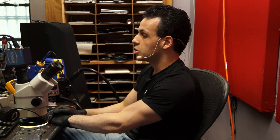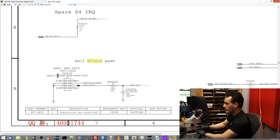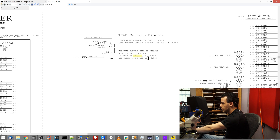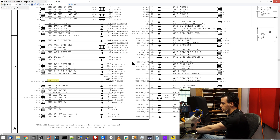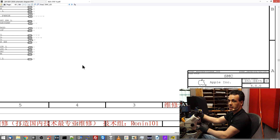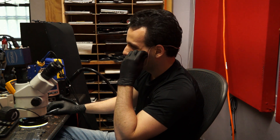Now they have a magnet and a hall sensor to do the job. Going back to the schematic, you can see the hall sensor labeled in the drawing. SMC_lid_R is a signal that comes from the hall sensor, then it goes through a zero-ohm resistor where it becomes SMC_lid. SMC_lid goes straight to the SMC — the System Management Controller — which is what manages whether the machine thinks it's open or closed.